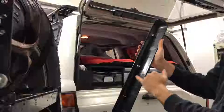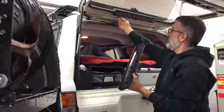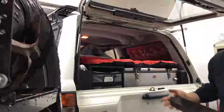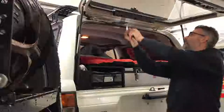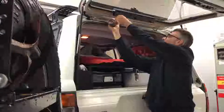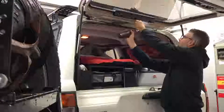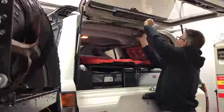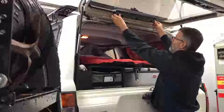And as you can see, there's three more metal clips that feed up into the holes on the back side of here. So once you pry those pins out from here, you're going to pull the cover and kind of rotate it out and straight back this way. All right, to take the third brake light down now that the cover's off, we're going to use an 8mm socket to take these three bolts out. And then the third brake light should go this way towards the bottom of the upper tailgate. Just like that.